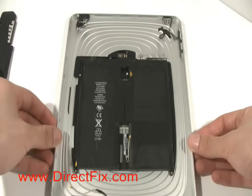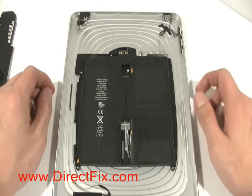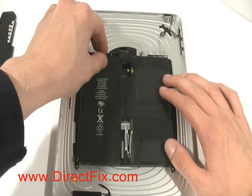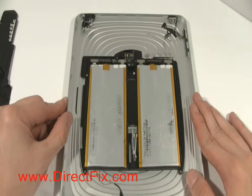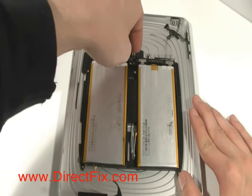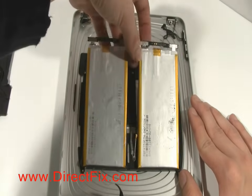The batteries are the two large black bricks in the center unit. They are covered in a thin tape. They'll need to be removed before you can remove the batteries. With the thin black tape removed, you will now be able to remove the battery assembly.